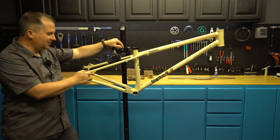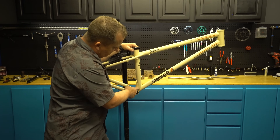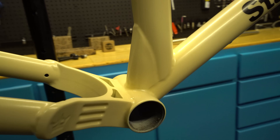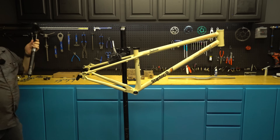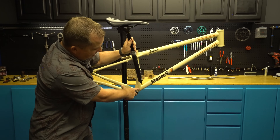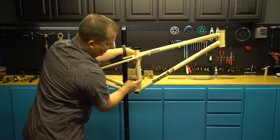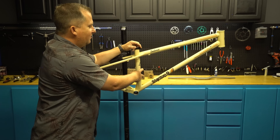This is made out of 4130 chromoly steel and we've got a threaded bottom bracket. You'll notice my signature design: all my signature bikes have this completely straight seat tube that intersects the down tube ahead of the bottom bracket. There's actually a hole inside for the dropper cable to stay completely internal once it pops in. That allows you to get a longer dropper in there, because if we put a window and brought the port back, as you get lower and lower the actuator takes up space. By keeping it fully internal, we're able to get longer droppers on here.